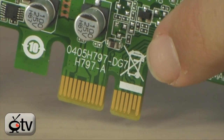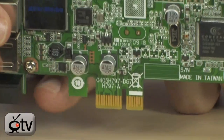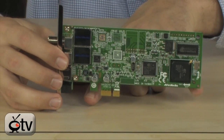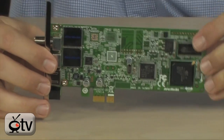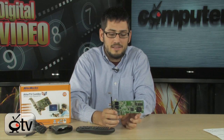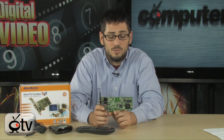Now, note that this is PCI Express X1 — that's how it connects to your computer. If you don't have a PCI Express X1 slot, it will also work in just about any PCI Express slot, as long as it's PCIe. So if you have an X16 slot, it can fit in the first part of it and will work, or it will fit in an X8, X4, or finally its intended X1 slot.